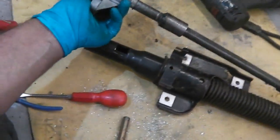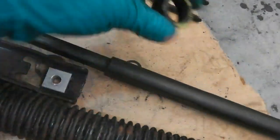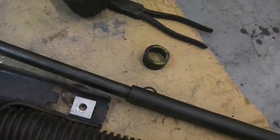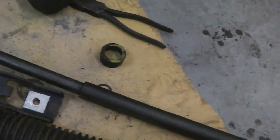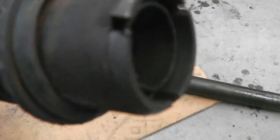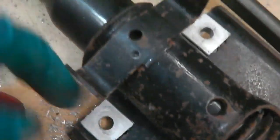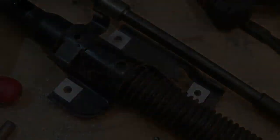So steering column disassembly, a couple of parts, I'll just go through it again, what you've got: that bottom seal, like a plastic bushing, then you've got your actual bulkhead seal, so that plastic bushing is sitting in the end. There's a little piece to take out here now, a little grey plastic, another bushing, which is just held in with some tabs that are bent over, so we need to get that out, otherwise that'll be melting. Then these to slide out, and then that's the casing done.